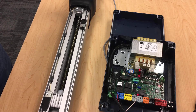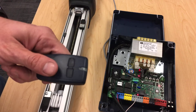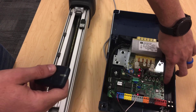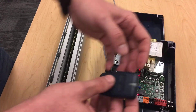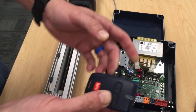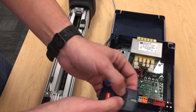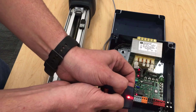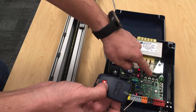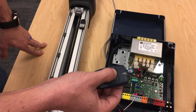We should be good to go. Now the next step is to program our remotes. Your S1 button is the one on top, and you have to make sure you get the hidden button. Click S1 and you'll get a flashing green light. Squeeze both buttons and you'll see the green light turn solid. Release, then quickly tap the button you want to use and you'll get a fast flash, and then it should time out. And of course, good to go.